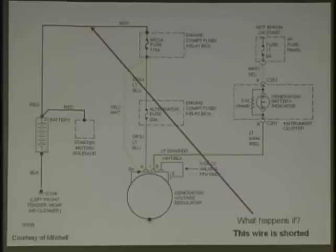Okay, now. Fire. If the vehicle was charging, and it was running at the time, is anything going to happen to that fuse? Let me ask you something. That fuse is a lot more than the amperage of the alternator, right? A lot more. It's a 175 amp fuse. All right, if that was a 100 amp alternator, could that blow that fuse?